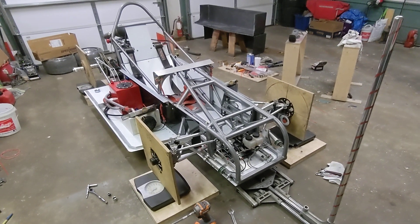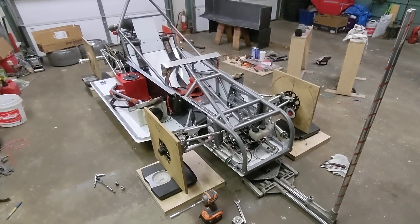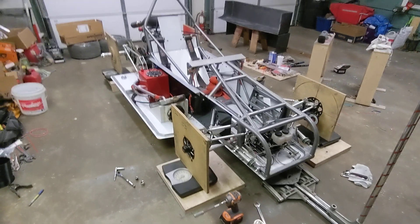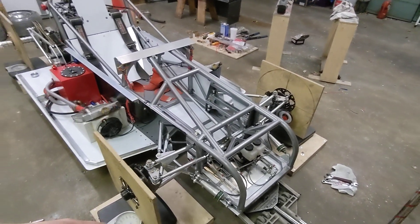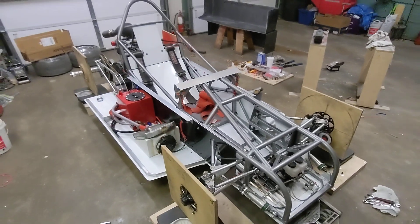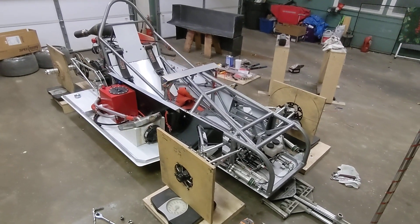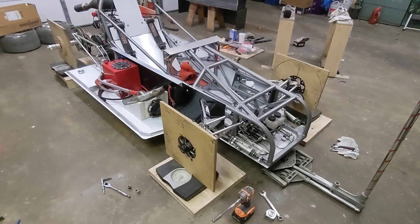That was a long day — luckily the wife got me a margarita, that was wonderful. Look at this: we're stepping backwards, we've got wood wheels, they're square. This is how I line it up — allows me to make sure toe is accurate, get correct links, make sure everything's squared up on the chassis. It works out super well because you have this kind of flat, true plane that's in line with the wheels, so making measurements and lineups is awesome. Just cornered it, everything's dialed in.